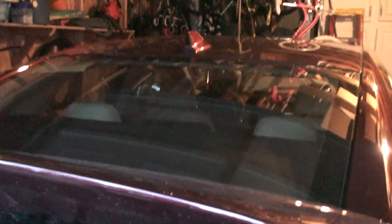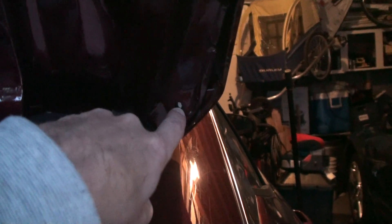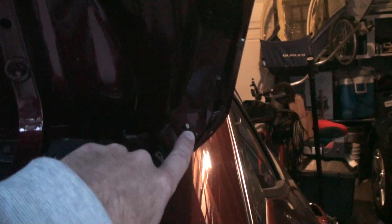I've just gotten the spoiler back on. Two things to note: first, the grommet for the tail light wire is under here — it's a little bit of a pain to get back into place, but you need to do that to keep water out. Also, there are four screws on little nuts that slide into place. I slid them all the way in, but you want to keep them out just a little bit — there are little tabs it slides along so it should snap into place, but not all the way. I think I'll be able to fish them over with a hook in there.